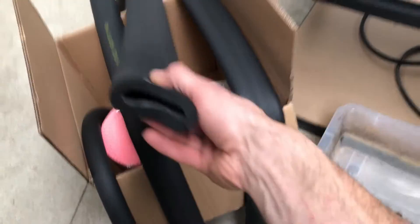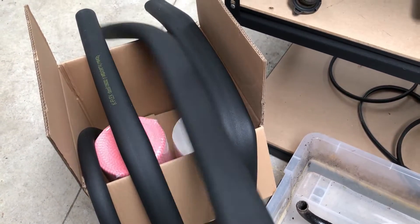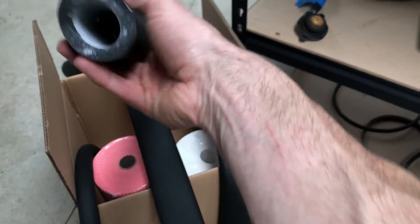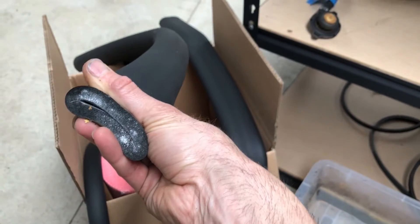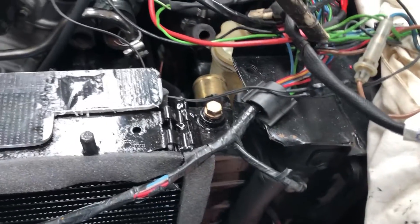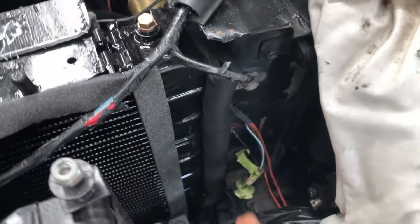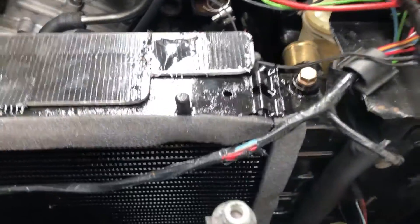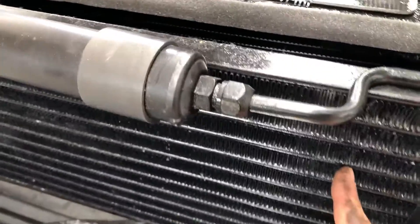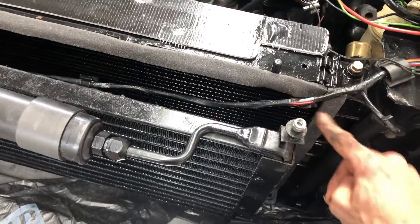I'm using this pipe insulation which I got from a local hardware store. That's going to go in at the sides of the radiator and at the top. I've got a couple of different sizes and that should squish down and also be heat resistant. This pipe insulation jams in quite nicely on one side of the radiator. I don't think it's going to dislodge, but it should stop air from bypassing the radiator and going through the path of least resistance — which would mean air going through the air conditioning radiator, which is not yet in place. It will sit further back against this foam of the original refurbished radiator.